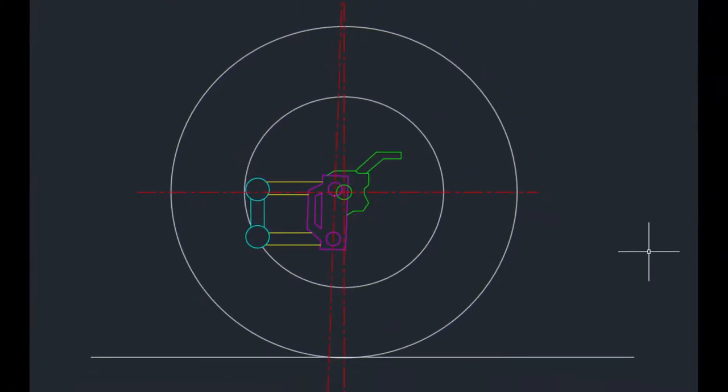Let's look at the drawing. We're going to look at the geometry. The green is the spindle, the magenta/purple is the link pin carrier, the yellow is the trailing arms, and the cyan/blue is the beam. This is the stock setup. I understand that the trailing arms are not really that way once the car settles, but just as a starting point I left them horizontal, parallel to the ground, so we can look at raising and lowering the car and seeing where the caster shims get placed.